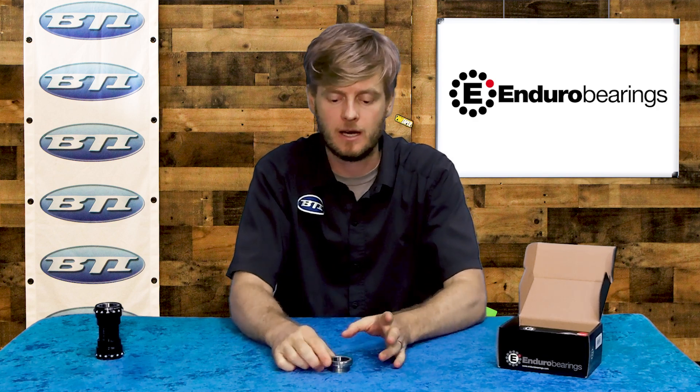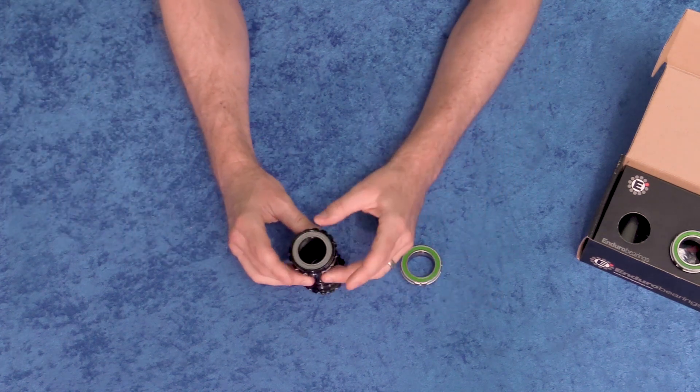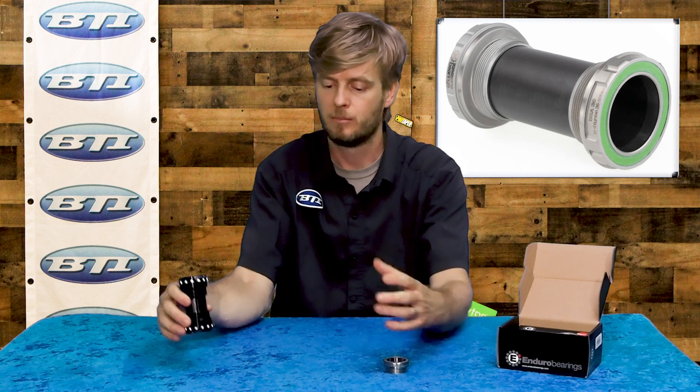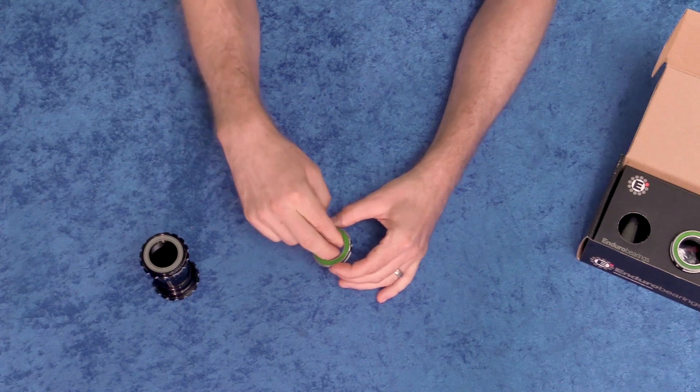They developed the Max Hit bearing line to highlight that finding. What they've done is build the bearing into the bottom bracket shell itself. In a traditional bottom bracket, there's an exterior aluminum shell and the bearing is pressed into it — meaning it's easier to remove and upgrade over time. The goal with the Max Hit line is to increase longevity so you're not doing nearly as much maintenance. They've used the outer shell of the bottom bracket itself as the outer race of the bearing. The goal was to gain a few extra millimeters by removing that extra layer of metal, allowing them to use the biggest balls possible in this standardized size.